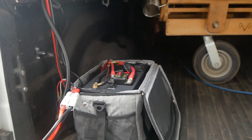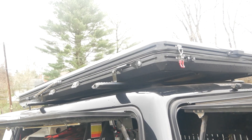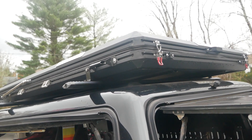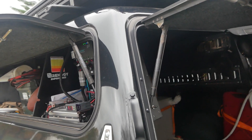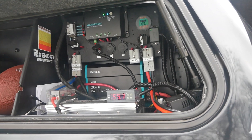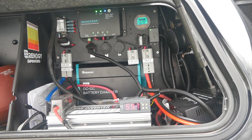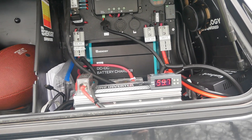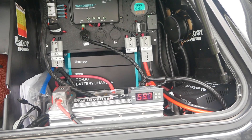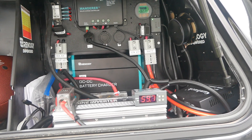This is my pickup truck, and I have a Roof Nest Falcon rooftop tent. When I'm using the truck I still need to have connectivity with cell phones, charging cameras, and other things. So I needed to install a solar system, an inverter, a DC to DC battery charger to charge the battery off the truck when it's running, and I also have a hookup so that I can charge the batteries in my travel trailer from the truck while we're traveling.